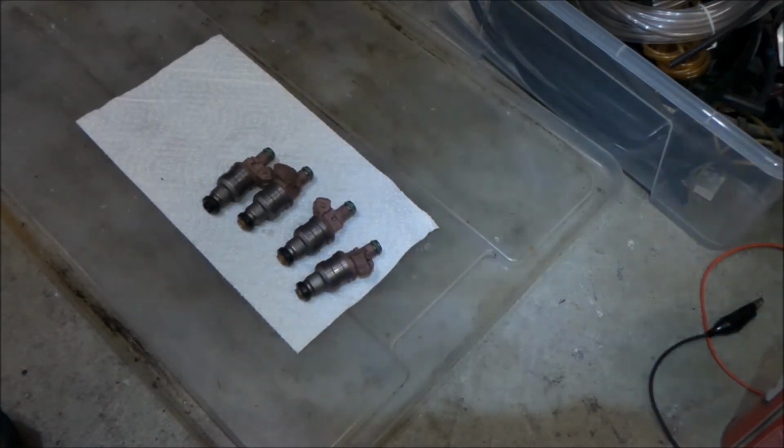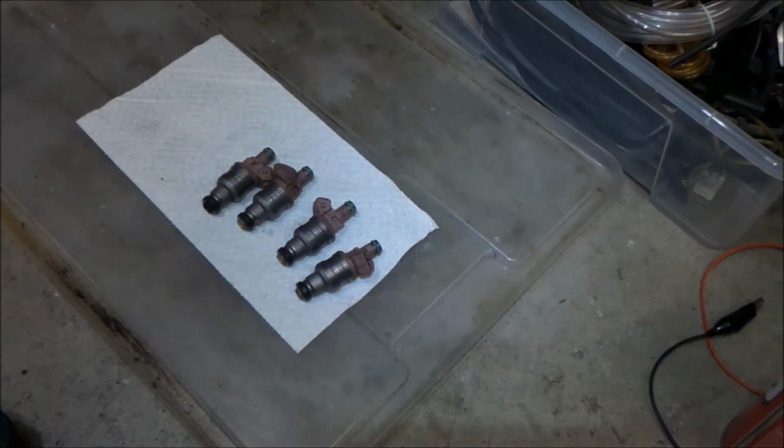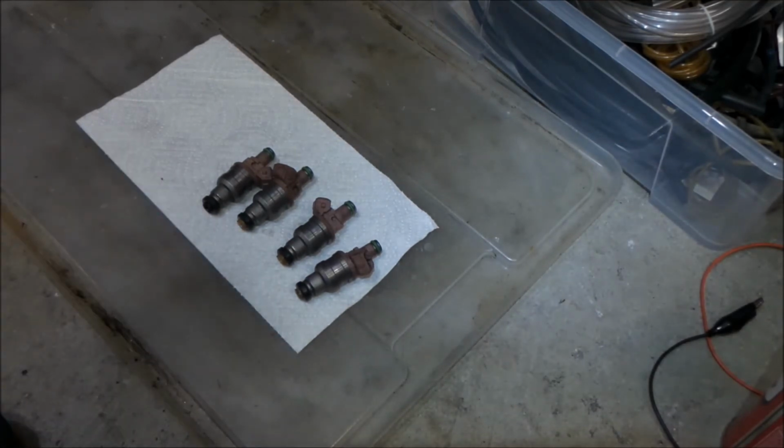It's fine. It's for cleaning fuel stuff, and it's plastic safe too. Carburetors have plastic parts in them, but as much as possible you don't want to get any kind of chemicals on the plastic parts. But it was designed for gasoline to flow through it. I have never had these injectors cleaned or flow tested, so hopefully they're okay. I hate to say it, if the car doesn't run right, it's probably because Hades Omega messed the injectors up, or they're dirty and we didn't clean them properly.